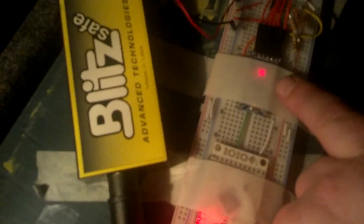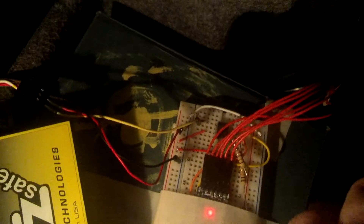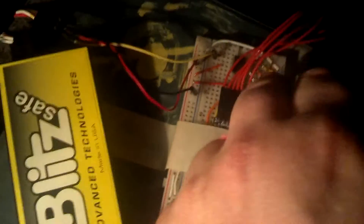This here is a little Arduino mini, got it covered up so it doesn't slide around, taped down. And then here under my programming wires — those red wires — is the MCP2004. That's the chip that handles the transceiver from the iBus, the iBus connection. You can see I've got red and black — power and ground — and then the yellow is the iBus. Those two cables coming out of the tray are meant for the CD changer, which I don't have.